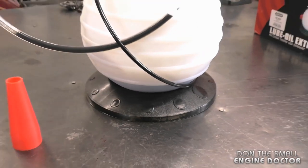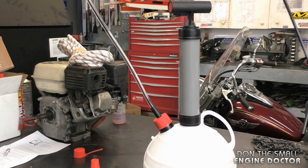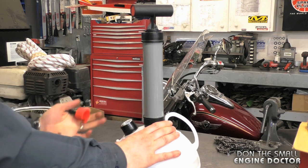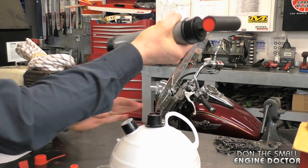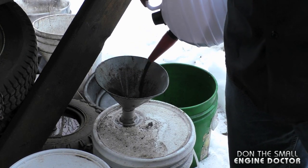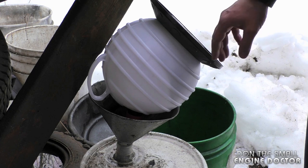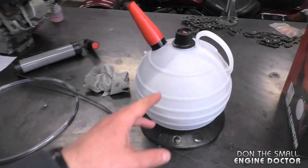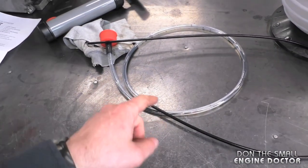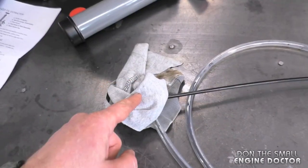You can see the oil in the bottom from the lawnmower. Now I'm going to show you how to drain this little tank. If you want to get the rest of the oil from the hose down into the tank, you can hang up the hose for a while and it will all drain into the tank. I'm just going to unplug it, take the pump off, put the spout on, and dump the oil in my waste container. If you want the extractor to be completely drained, you can let it sit upside down and it will eventually completely empty itself. Just a quick tip — if you are putting the line away with a bit of oil in it, you may want to have a rag sitting underneath the ends of the line because there will be a bit of oil that will come out.